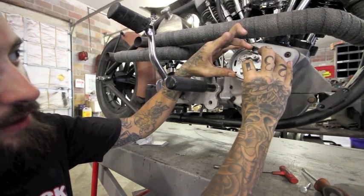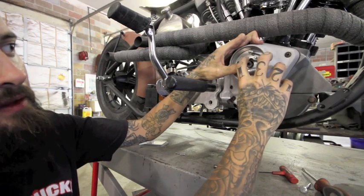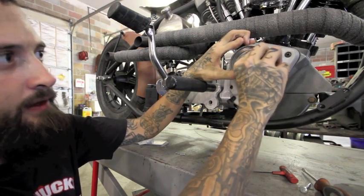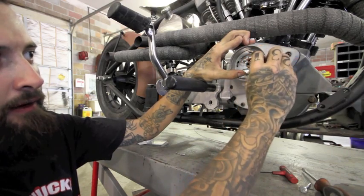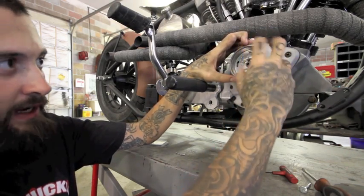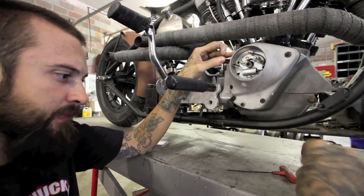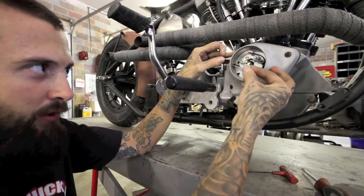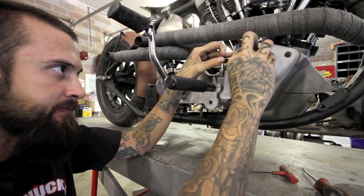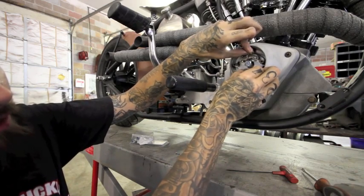Make sure when you're putting it in that the weights don't move, they don't turn somehow, letting this fall on a flat spot. And then you will put in your standoffs and keep them loose because we need to time it yet. Last and not least, bolt your weights to the cam. And that's how we're going to time it.